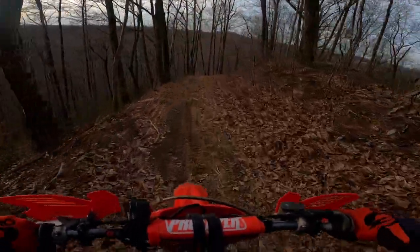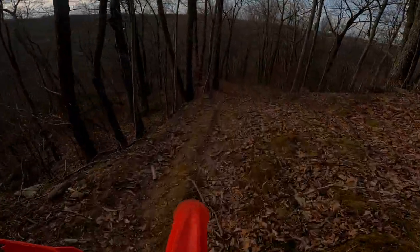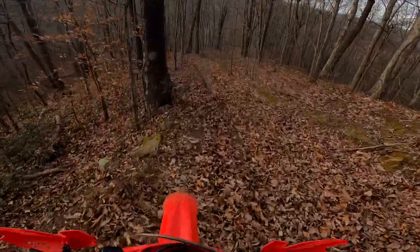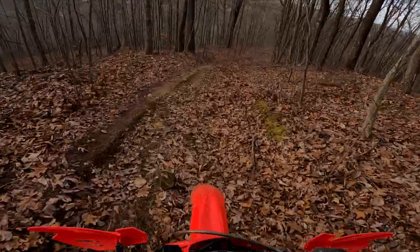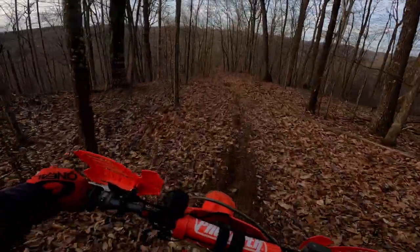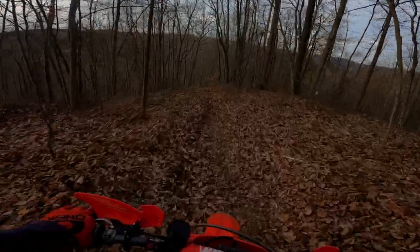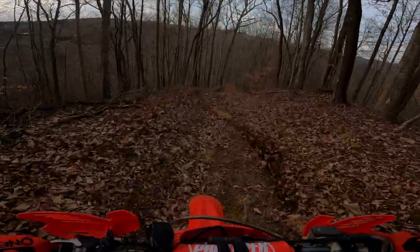Whew, that would have been an accident. Slow, typical riding. I think I need new clutches in this. It keeps dragging. I got it in first right now with the clutch all the way in, and it's trying to die when I speed up. I've got it adjusted pretty far out too, so I'm assuming that I need some clutches, or a clutch basket or something. Maybe just some plates that I might be able to get away with replacing with some cheap plates.